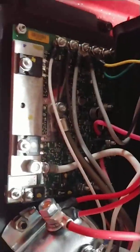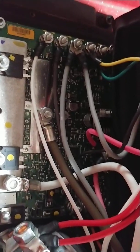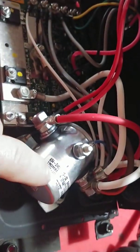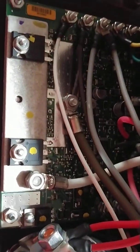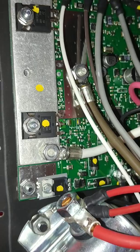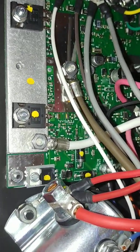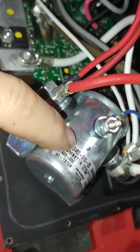So now that you're inside the box, here's what the inside looks like. From research online, these are usually burned out, and usually there's a burn spot on the board somewhere, or this 24-volt solenoid is going bad. I'm not seeing any burn spot in here on the board. That doesn't mean these components aren't burned out, but they don't look burned out or damaged.